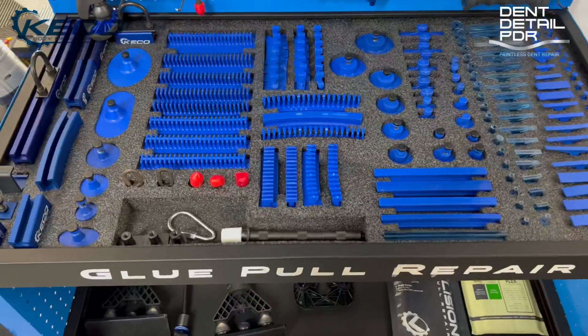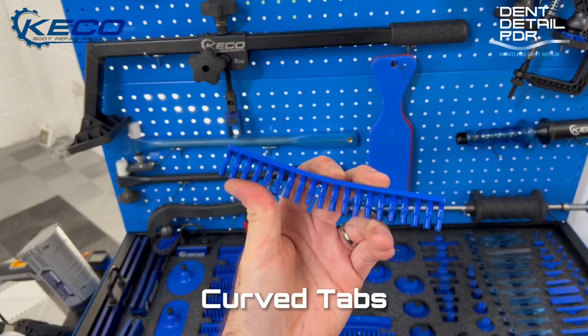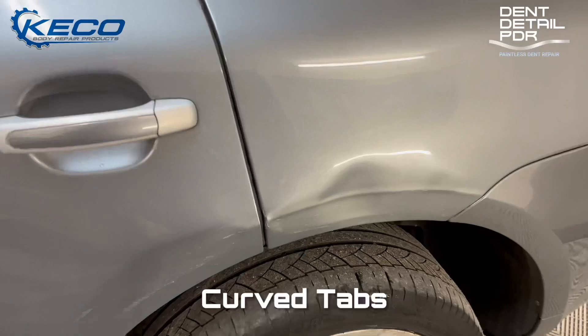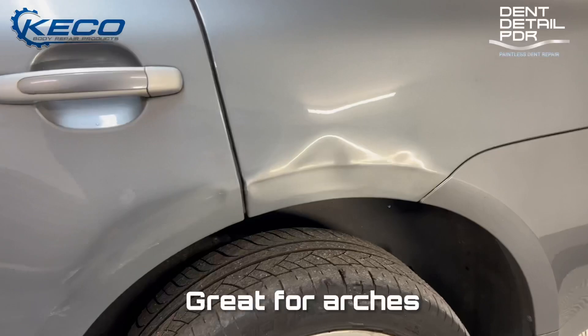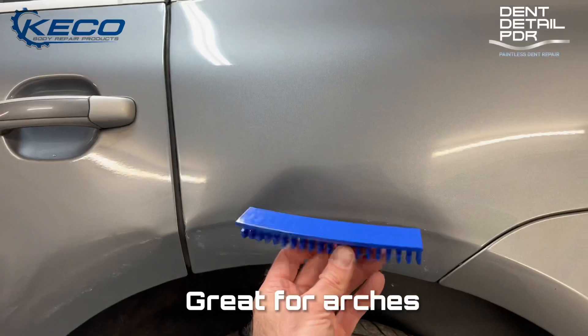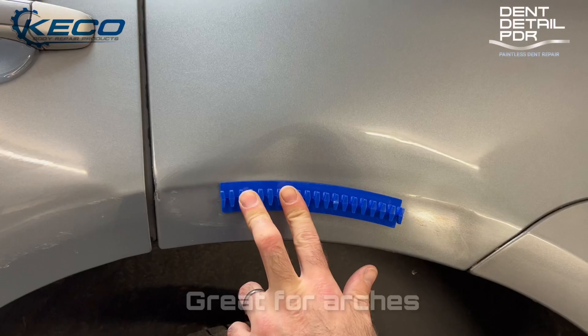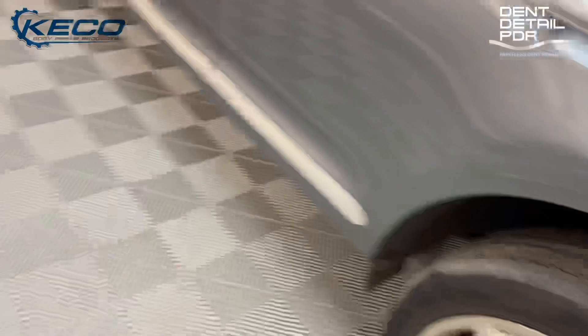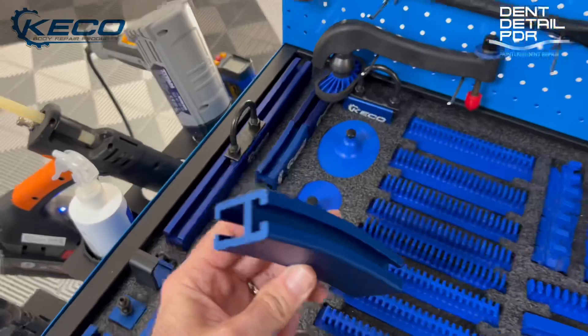Next, the curved tabs — these flex so they'll follow the shape of the panel. The job to the right is a Porsche with a nasty hit on the quarter and door. It's going to a body shop because the paint is broken, which is perfect for the GPR system. We can quickly rough out all this damage — save on filler, save welding, save pin pulling, save a lot of product, and ultimately speed up the repair. These curved tabs are perfectly designed for damage like this. You can work your way along, put two on there at once, use the bigger tab tracks, and quickly bring all that damage out. There's also a curved puller that sits over the panel and uses one of the beams to pull it all up and out in one go.